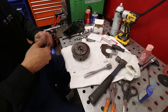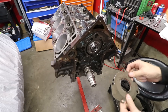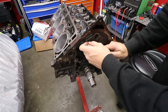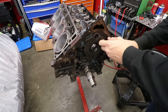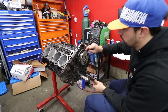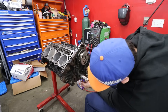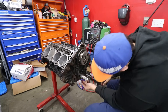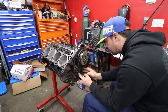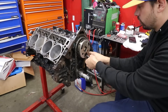That's what it looks like flush in there — I had to hammer it a little more than I wanted to, but the plate just slides back over and it's locked out. These bolts are 14 foot-pounds, so that's pretty tight. Next we put our cam plate back on — it only goes one way. I can't find a quick torque spec so I went mechanic tight. There are two little markings on the chain, a mark on the cam sprocket, and a mark on the crank — as long as all those are lined up and you put your tensioner on, you should be good.